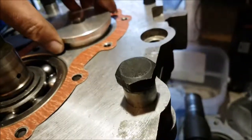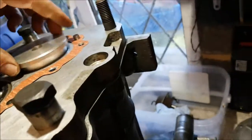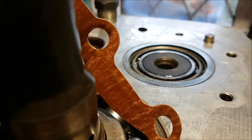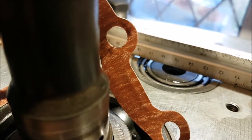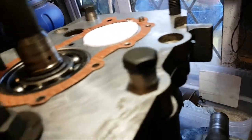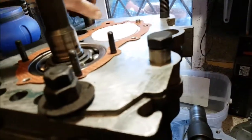So I've pushed the bearing cup in using aluminium drifts — just lifting the plate up. I've released the front plate from the main gearbox housing by undoing the four lock screws, lifted up, gave it a tap with the gentle persuader, and confirmed that it's gone in by applying the shim and double checking for a gap underneath — there was a gap, and there no longer is. In fact there's now a significant gap between the shim and the ruler, so it's gone in quite a way. I've cut some paper circles, going to put them on there, bolt the oil pump cover on first, then nip the end plate up — these things need to be torqued up to crush the paper, then we'll recheck the tension.